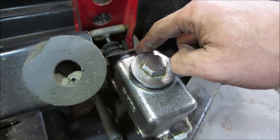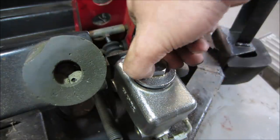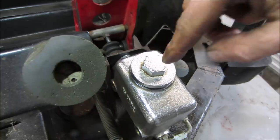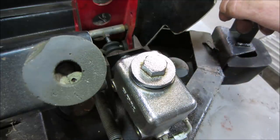That little hole that I showed you down below, the fluid needs to drop down in there when there's a vacant spot for it to go. But if this was blocked off, it would just hold the fluid level, the same scenario as the straw. So that's why it has a little vent in it, to allow for expansion and contraction, and for the fluid levels to drop down into there.